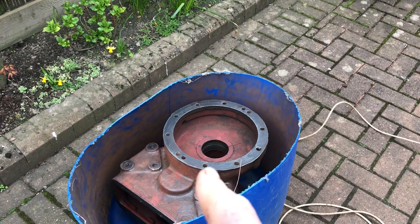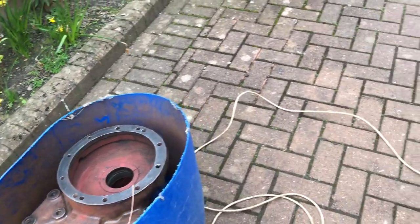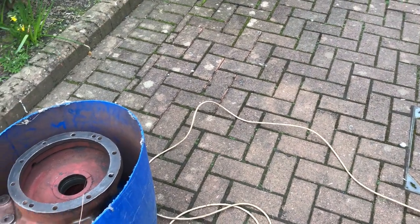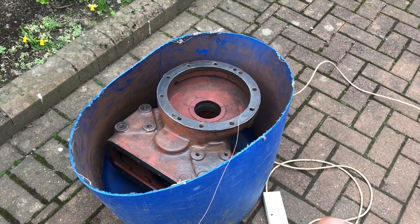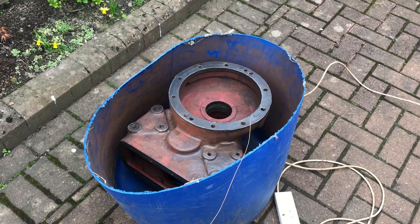What we're going to do now is get some buckets of hot water. I'm going to put in a cup of soap powder - apparently that's not because it gets it nice and clean, it's because it increases the conductivity of the water from the positive to the negative. It's worked for me in the past. I've done the manifold and I've done something else with electrolysis and it came up really, really good. We'll give it 24 to 36 hours and have a look at it, then we'll decide whether it needs more.